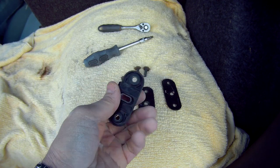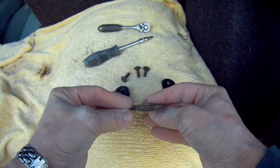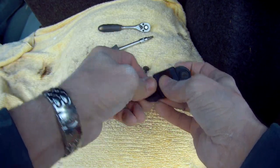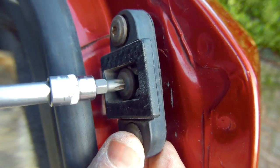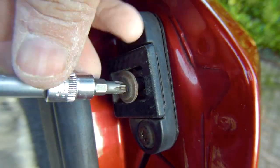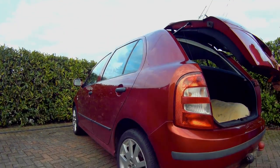So I decided to raise the bracket by cutting out some plastic from the back of an old oil container, cut round to match the base of the bracket, and drill some holes for the bolts. Once I fitted the shim, I found it eliminated the knocking noise completely. So I decided to put two shims on each side so it would allow me to have some future adjustment, which worked perfectly.